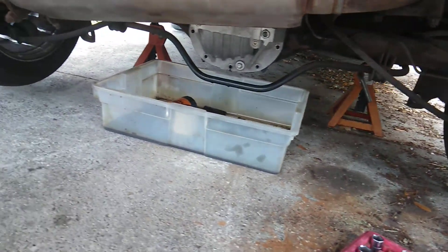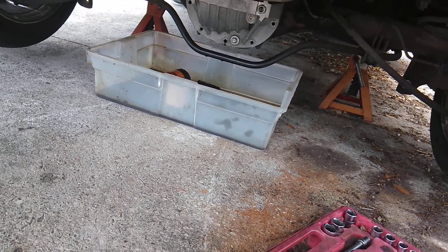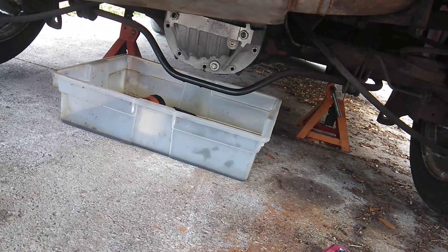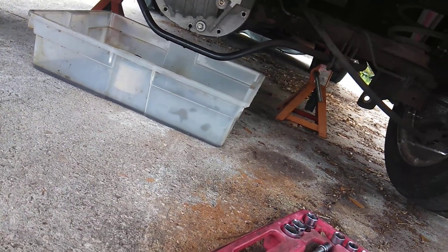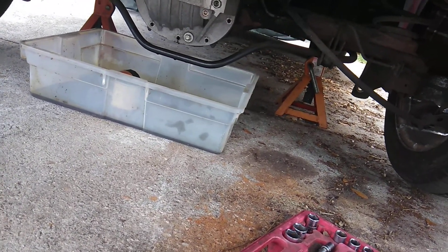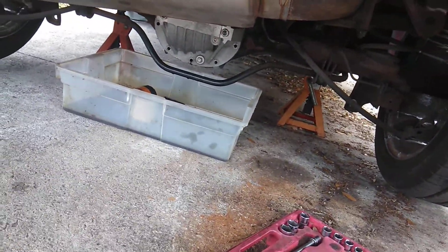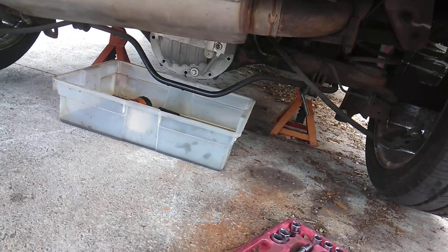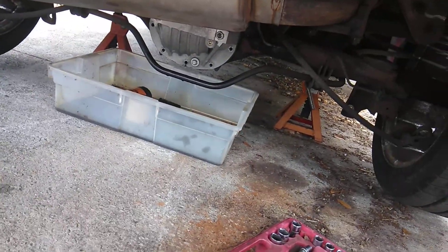For the rest of the day I'm going to remove this, put the torsion in, change the seals on the torsion, regrease the bearings and axles, put it all back together, make sure everything is tight, put the diff cover back on — I just finished painting the other one — and get her going with fluid in it. I decided if the rear end was bad I was going to throw everything else at it, so I'm going all out: torque arm, three-point frame connectors, and the lower.